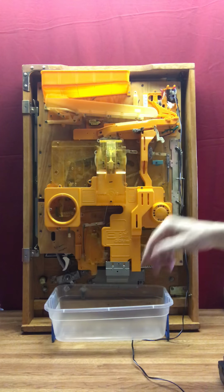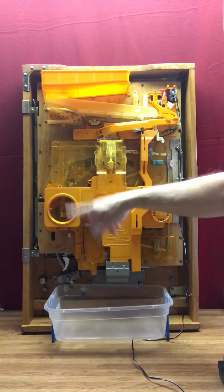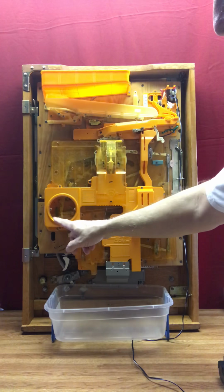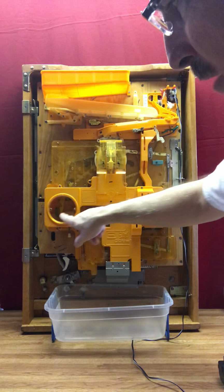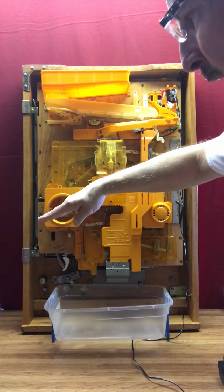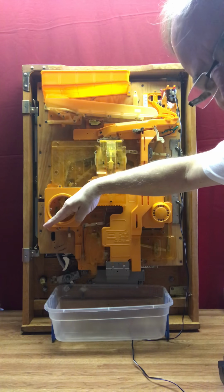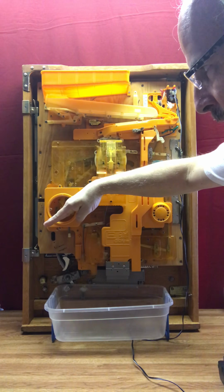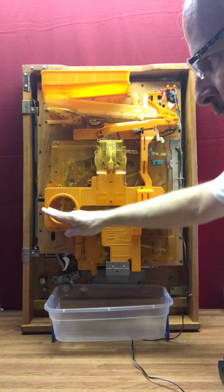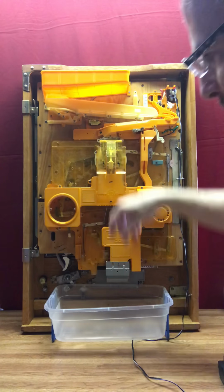So again, this you want to make sure will let the balls go through rather than dropping out of the machine. I'm sorry, this is the jackpot chamber. This is called the seesaw chamber, and in here is a white piece of plastic called the seesaw, very enlarged, if you will. It sits on an angle like this, and when a ball comes in, the ball weight tips it down like this. Again, a very, very exaggerated, but you can see it.